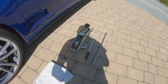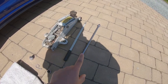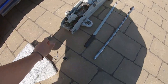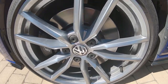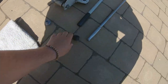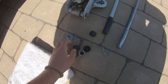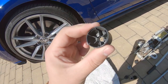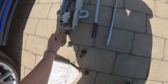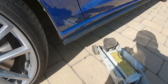To get started, here are the tools you're going to need: a jack, a bar to fit the socket on, a cap puller so you can get the wheel nut covers off, and your locking wheel nut key. First thing you want to do is go around the wheel with the cap puller — put it in like this and pull it off. One of them looks different on the inside to the others; that's the one that goes over the locking wheel nut. You'd be surprised how many people don't know that — keep that safe.